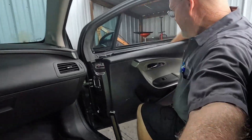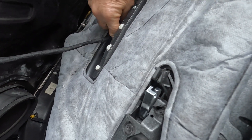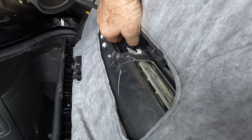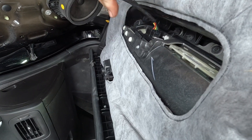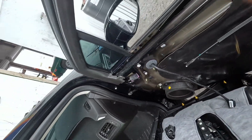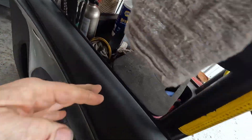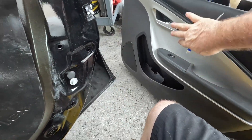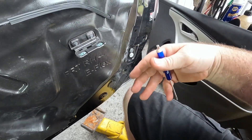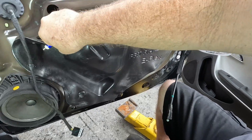This is just a little cable for the door handle that snaps into this bracket, and then there's an electrical connector for the switch with a little release tab — it's a bit of a bear to depress and pull at the same time. Try to never lay the door panels on the finish side. Lay them inside-facing down so the visible side faces up and doesn't get scratched. Some people don't even think of that.